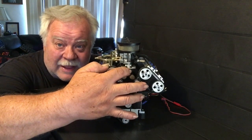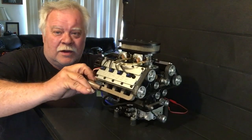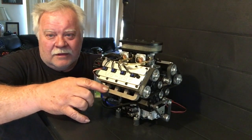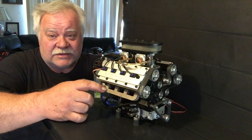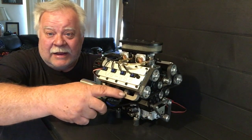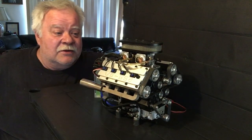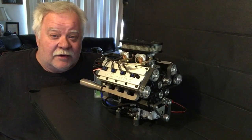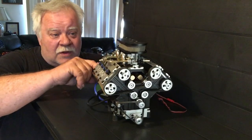It breathes very well. From the intake manifold you can see it's got like an air gap intake manifold that keeps the air and gasoline cool. And it comes into these really nice, well-tuned exhaust manifolds. This thing breathes very well with just these log manifolds — they remind me of the old Chrysler Hemis and big-block Chevys, and those things put out massive horsepower with just manifolds.